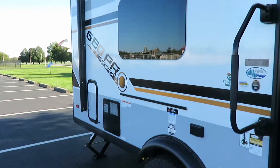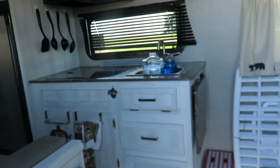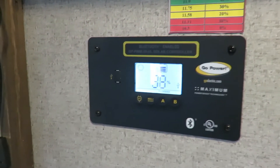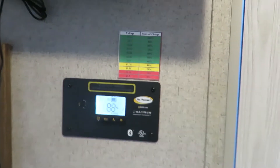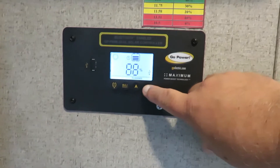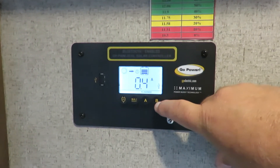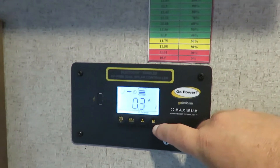So we're going to get an idea of where we're at to start with. I just unplugged and I'm going to go in here and check what we've got. Looks like we're starting with about 88% on the battery. Not sure why it's run down a little bit since we've been hooked to the car, but we'll check that percentage in the morning. It's 88% and voltage is 12.8, and we're drawing barely even half an amp right now off the solar panel.